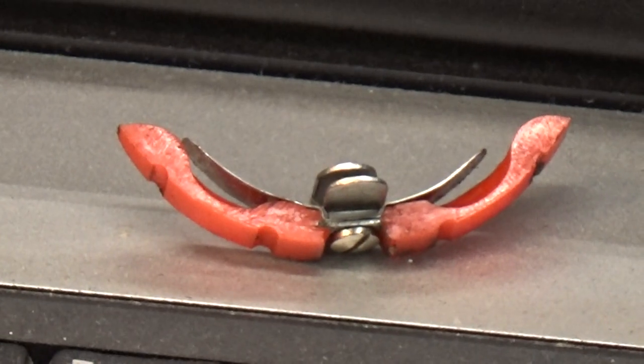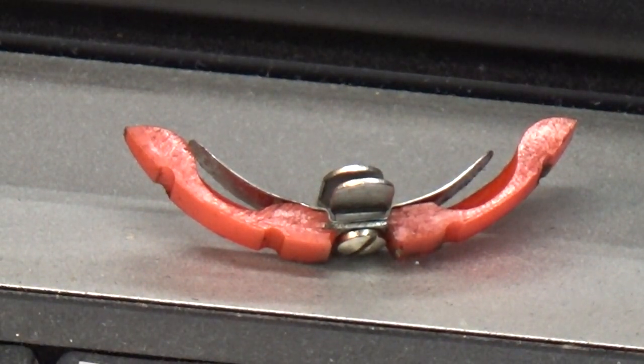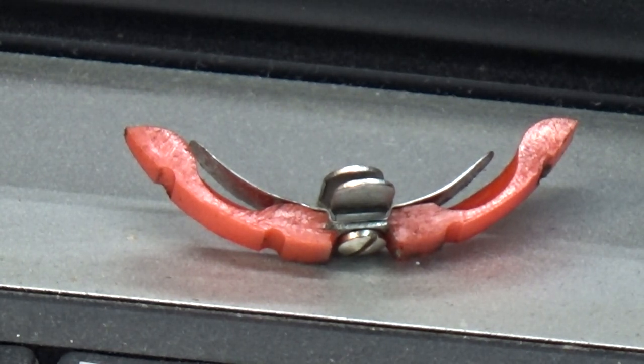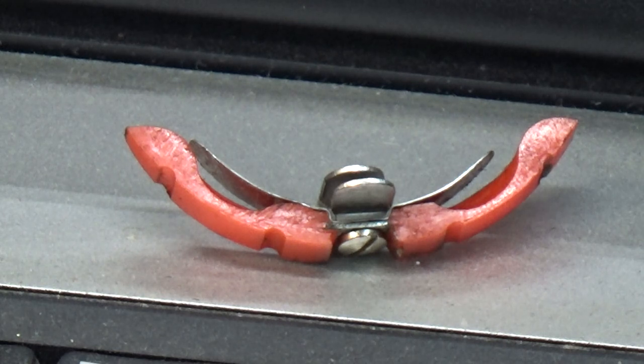And it's designed to bind and to catch some of the junk that otherwise would be rolling around inside of the raceway, and keep that raceway cleaner, keep the quality of the stitch there, keep the machine running efficiently. That is the design concept. But what I found is that it can also cause issues with the thread movement in the raceway, and can actually sometimes cause thread breaking as well, no matter how many ways you try to adjust it. So at least for now, and I'm going to provide it with the machine because it's part of the original equipment, but for our purposes of sew-offs and everything, I've taken it out of there because I was running into issues with it not seating in tight enough and then getting kind of a wiggliness to it and moving around while that thread was trying to move past it and creating problems.